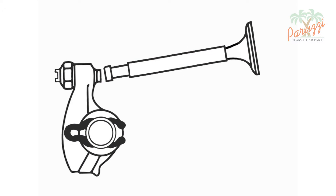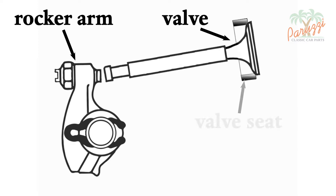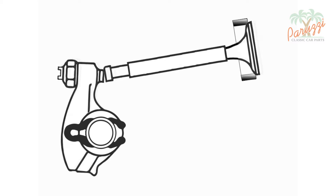Here we show a simplified drawing of a rocker arm and a valve. When closed, the valve will seal on the valve seat of the cylinder head. The plane of the adjustment screw which comes into contact with the valve stem is rounded. Because of its rounded shape, the adjustment screw will cause the valve to rotate with each contact with the valve stem. This rotation of the valve is necessary to prevent the valve from slamming into the valve seat.